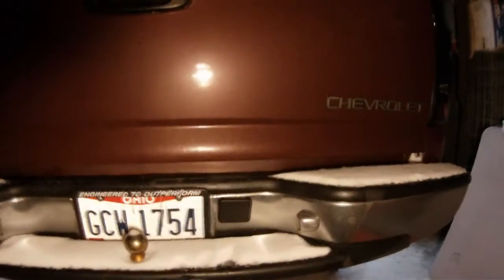So the LED is compatible for my license plate, which is nice. But the problem is when I go to fit it in this housing, it can't go in all the way — this part right here needs to be flush with the other part that's on the frame. That bulb is too long. And because that bulb is too long, it ends up hitting this plastic piece — that little cover. So the bulb is compatible with my plug-in, but it doesn't fit.